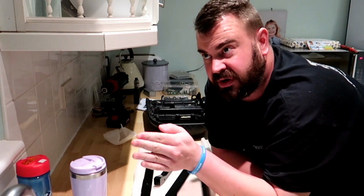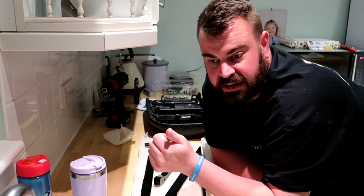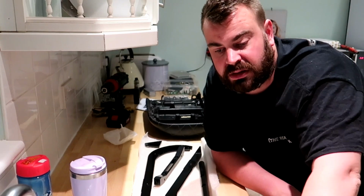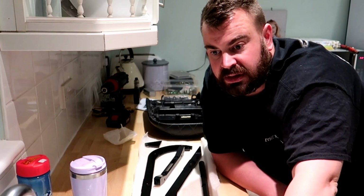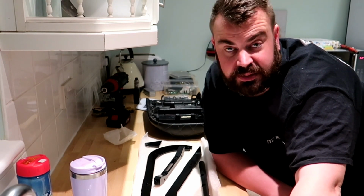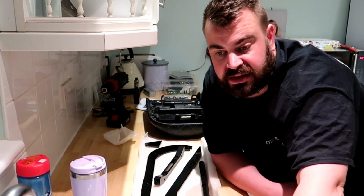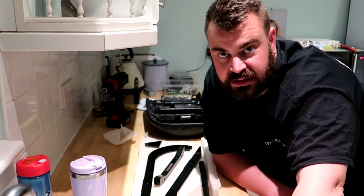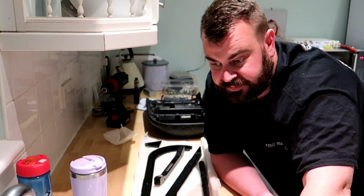Right, so a couple of days have passed. I've got the rear frame off, I've got the engine off. I've actually had a problem with the suspension mount. The bolt that goes through that holds it all together completely snapped. That's potentially due to how much it flexes. I couldn't extract it. We tried an easy out, we tried various other ways, so in the end I had to sacrifice the captive nut on it and get a little Dremel tool and take it off. It's not too much of a problem because I'll just put a nylock on the other side.